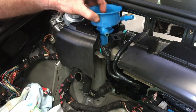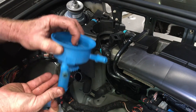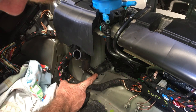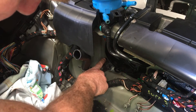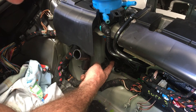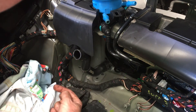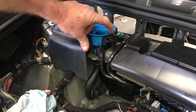Once it's up a little bit, remove that last hose and it comes straight out. The floater is just that small piece, and the level is determined inside the hose because it runs down to the bottom of the expansion tank and tells you the level in the reservoir. The hose that goes to the expansion tank has a single clamp — disconnect that. It's a hard pipe that goes from one side of the frame to the other. On the other side, underneath the air intake and really hard to get to, there's another one, and disconnecting that lets you remove the equivalent hose that goes up into the bottom of the expansion tank.